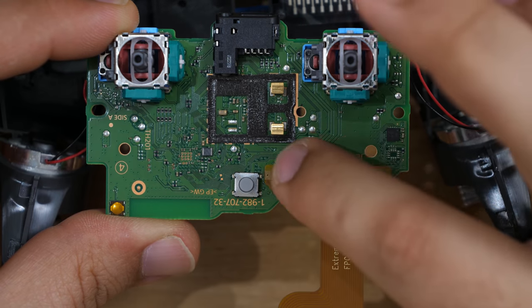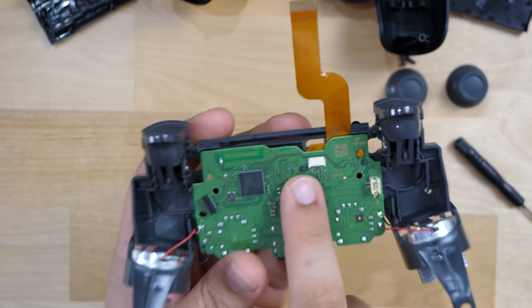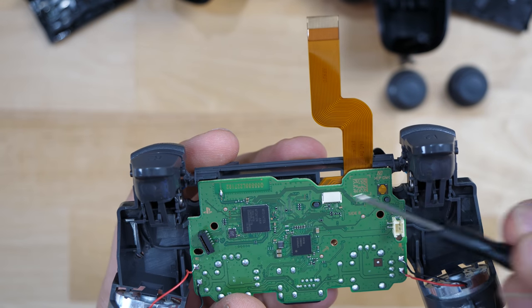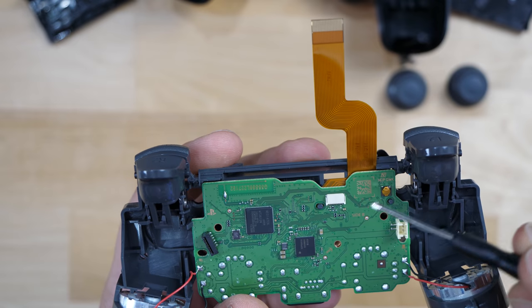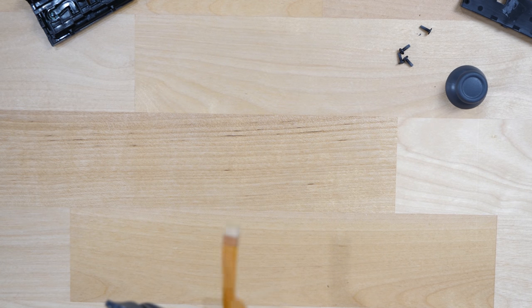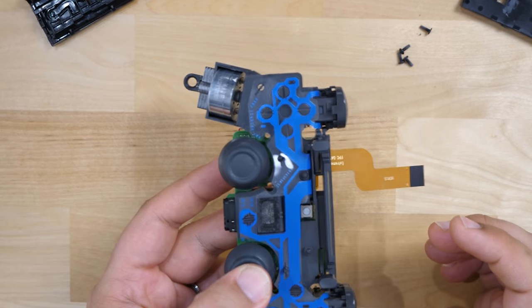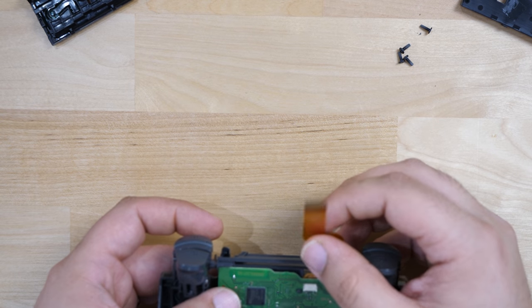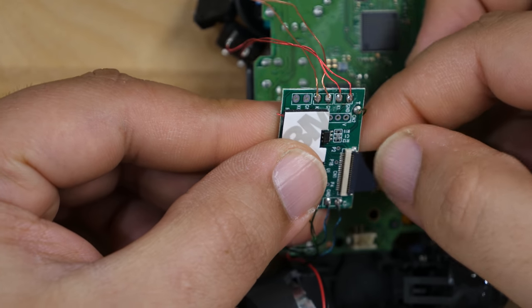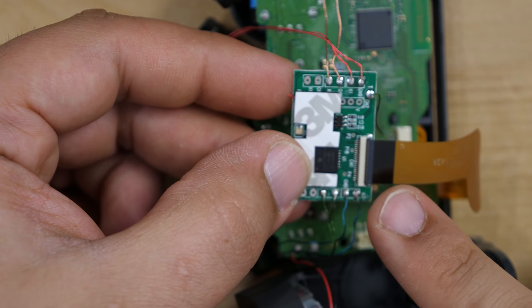You can put a little bit more tape here to give it extra security. Once you've installed the ribbon cable and put this back in, these little plastic bars should pop up above the board through the holes. The next step is to reconnect the DualShock buttons — just push them into the hole, they only go in one way, and when you press it you should hear it click. Now plug the ribbon cable into the actual remap board — slide it in, you'll feel it get snug — and close on it. Never apply too much pressure on these type of brackets because they break super easy.